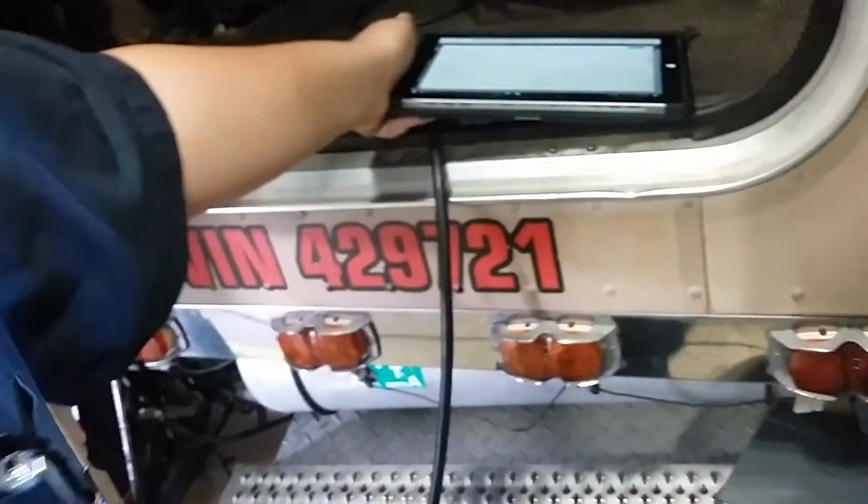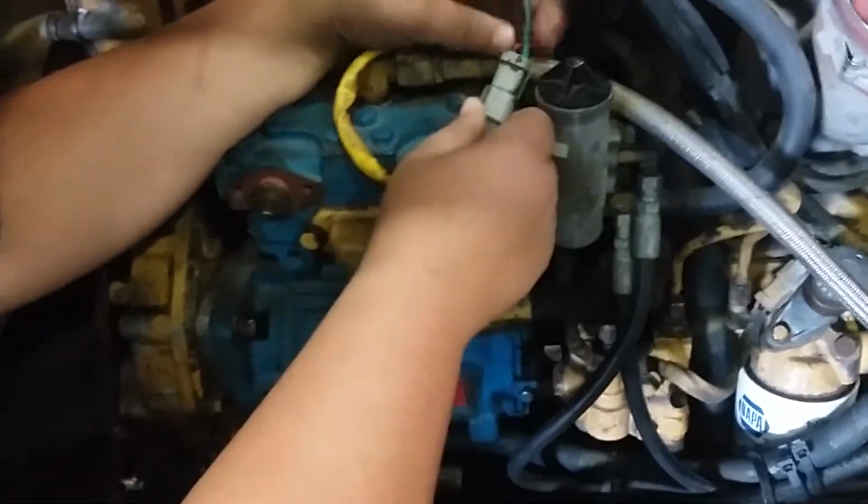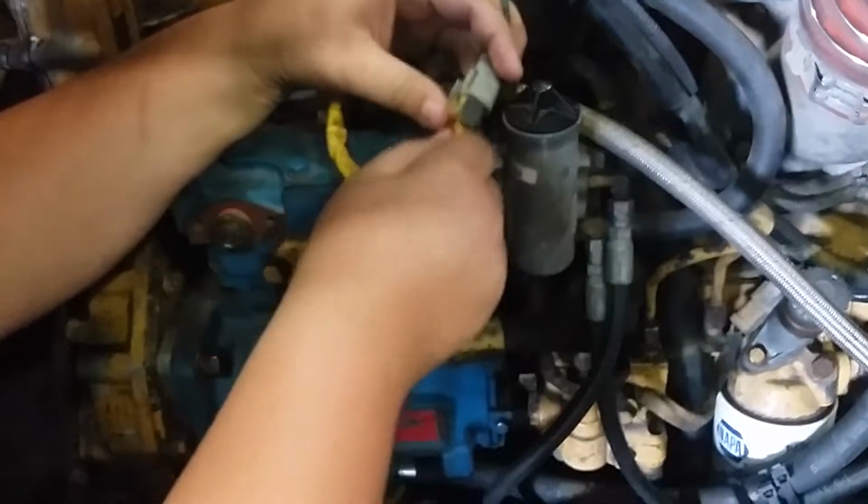It says the fault is active, which of course it is, so we're gonna go to step two, which is the 10-pound pull test. So you wanna come up to the sensor in question. You kinda just wanna pull on it a little bit, wiggle it, make sure that nothing is loose on both sides. Just make sure everything's put together like it's supposed to. All right, now we'll go to the next one.